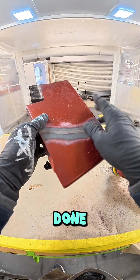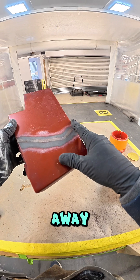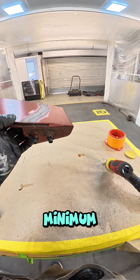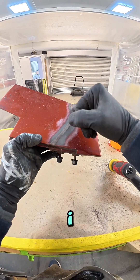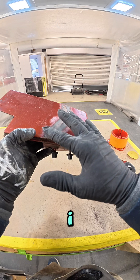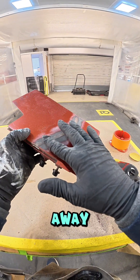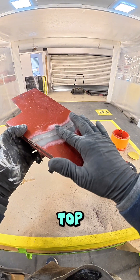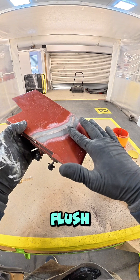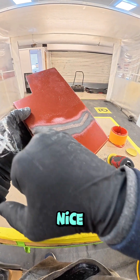I'll stop here to show what I've done. A lot of people would sand the paint away first, but that was unnecessary — I like to keep sanding to a bare minimum, just the area I need to weld. Now I'm sanding away the top level of the polyurethane ribbon I welded in, bringing it flush with the rest of the panel. I can still feel it's a little high here — all of this should be a nice gray color.